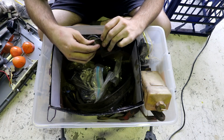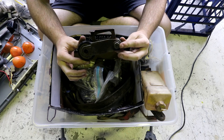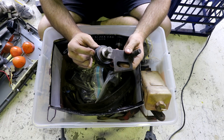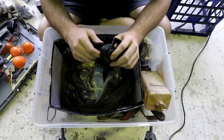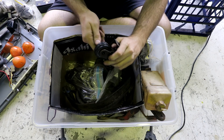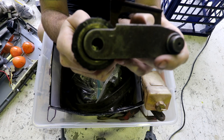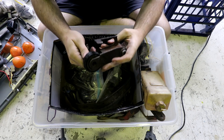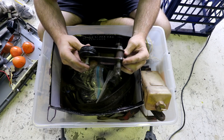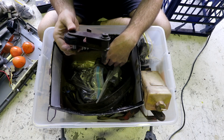Another brake line. This is one of the tensioners out of the rear chain case. The rubber all falls off these and they go brittle and old and fall apart. The difference is this one — someone's ground it out and I can't get this pin out. But if you can see down inside there, someone's center punched the pin to try and rivet it back in. So that's interesting. This was super worn as well. I'll mark that down as rear chain case tensioner. I'll have a lot of these — I've found heaps of them.